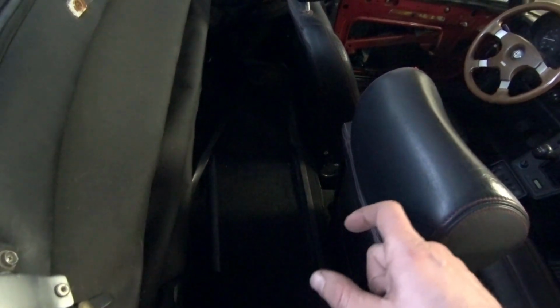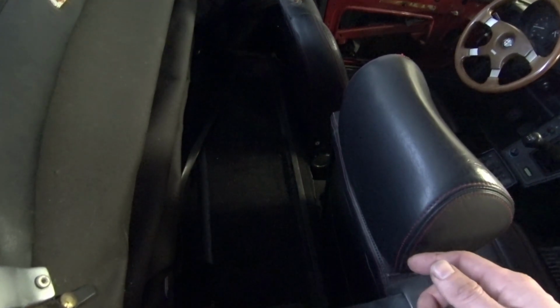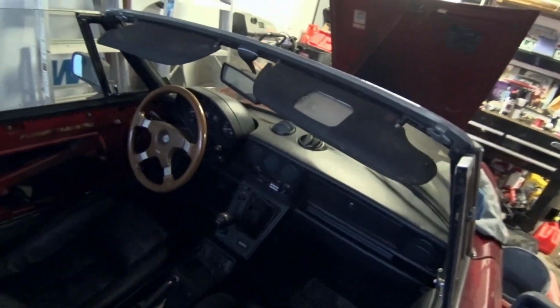Basically, the fuel injection computer is right underneath this cover. There's two relays in there, main relay and drive relay. The bigger relay controls the temporary power of the fuel pumps. The smaller relay energizes that second relay. I did take the smaller relay and put it in a relay tester, it'd kick on and then fail. So I replaced that, still didn't start, the fuel pump still wasn't kicking on.